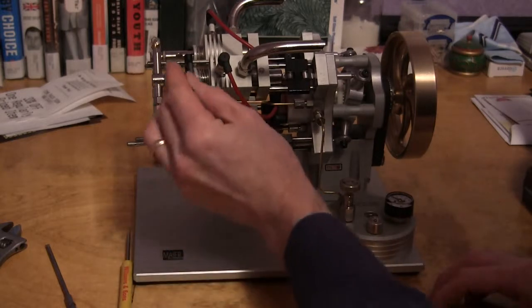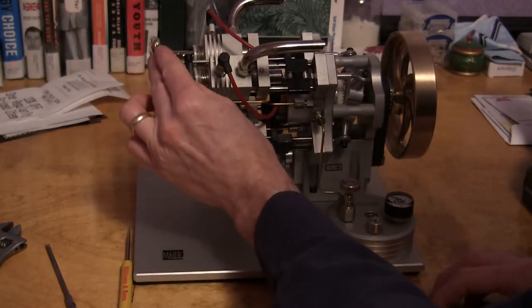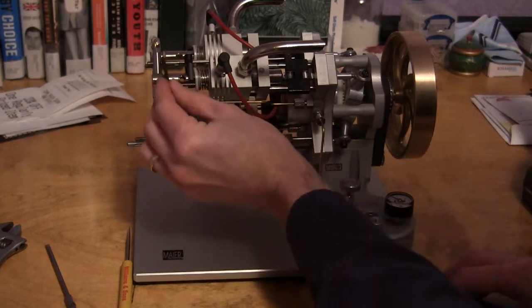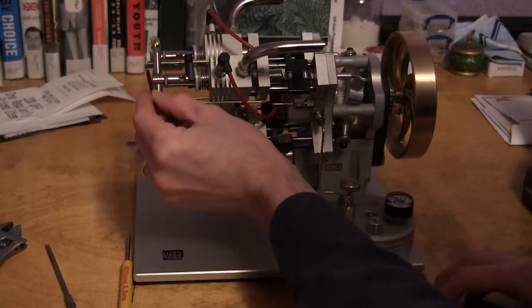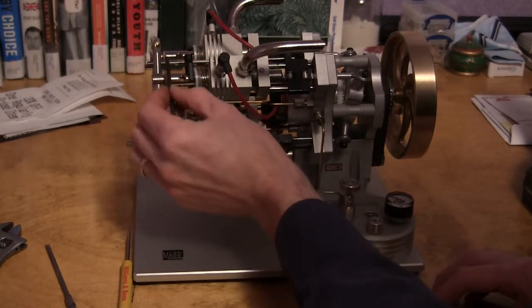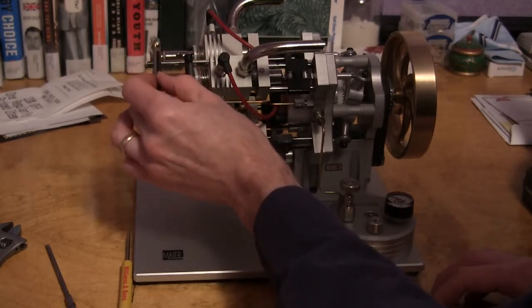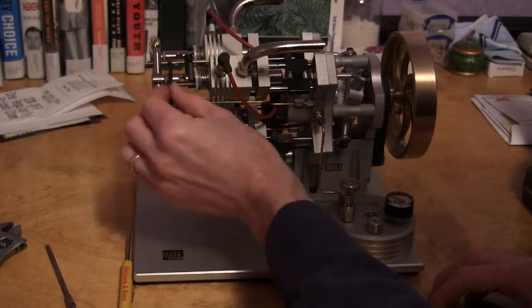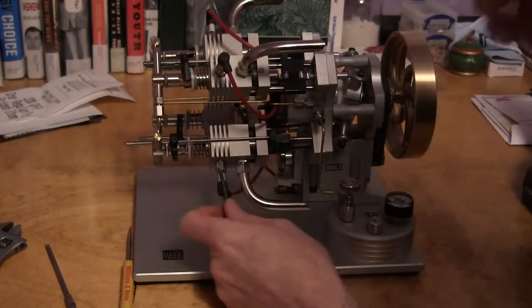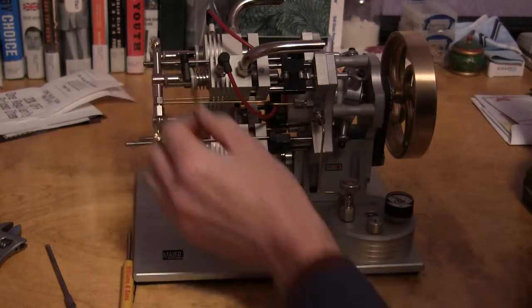And the other main issue is this little adjuster. You're basically adjusting your mixture with this screw. This little slant here determines when that valving opens. You want the valve to close, but you don't want it to be closed for too long. You want this to come down and push that valving open. So you can adjust that.